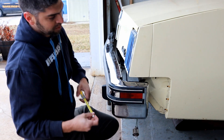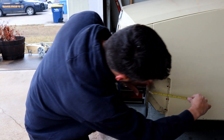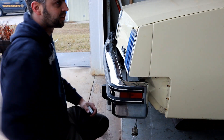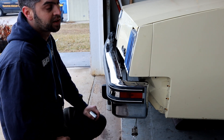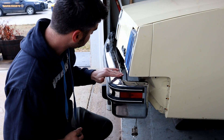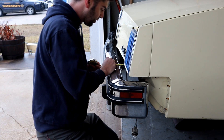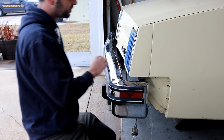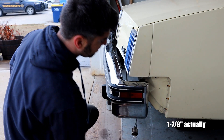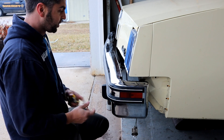It's going to be challenging to get far enough back, but I think we might be able to pull it off. The gap is about seven-eighths of an inch right now, and we're at four and five-eighths inches. So we need to go back like three and seven-eighths. I don't know if I'll get that, but I also want this flat spot of the bumper tucked up under the trunk lid. If I can go about two inches, I'll still be about an inch and an eighth down here, but I might be able to weld on a little thin piece to close that up. So yeah, two inches.